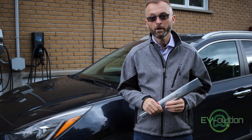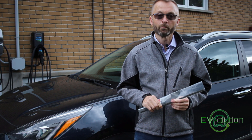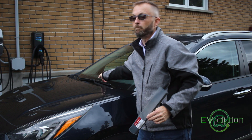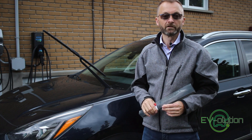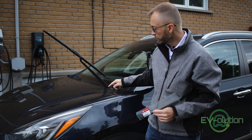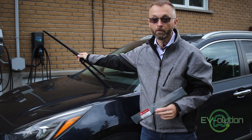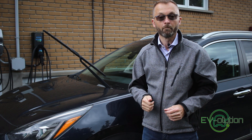I'll show you step one — it's quite simple to do — and then I'll show you how to install just the rubber blade and reinstall the wiper on the car. To remove the wiper from your car, start by raising the wiper arm. Just pull it up slightly and it should lock into place. Make sure your hood is completely closed when you do this because the clearance between the arm and the hood is quite close, and if the hood is up it will scratch the paint when you raise the arm.